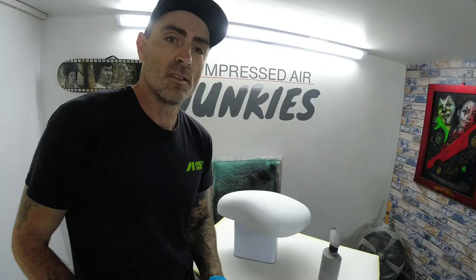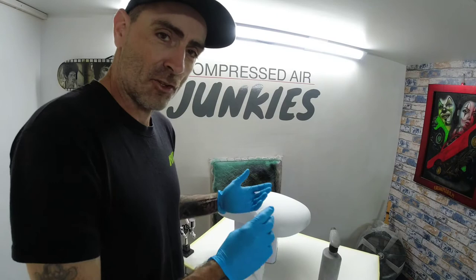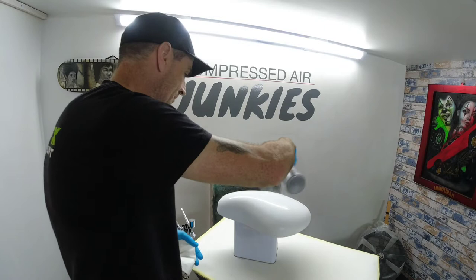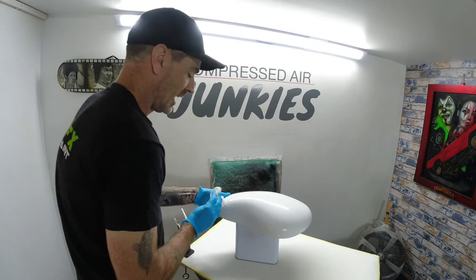Right, it's a bit noisy, guys, because I've got the extractor on, so I can talk to you without a mask, so it'll just go straight out. The first thing you want to do when you've got your panel prepped, get some degreaser, go over it like that, and then just give it a wipe down, hands up in, so just give that a good clean down, like that.